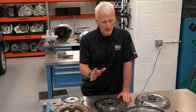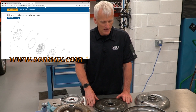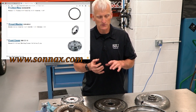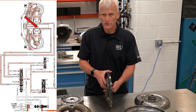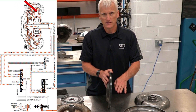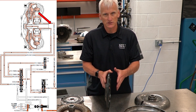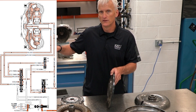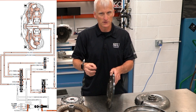The next phase is to get a remanufactured torque converter — hopefully with upgraded components — and make sure we flush the oil cooler out really well. During converter operation, transmission fluid flows through the input shaft during release mode, pushes the piston back, exits between the stator and input shaft, and because it's heated at that point, it gets directed to the radiator to cool off, then to an air-to-oil cooler, and then into the lubrication circuits.